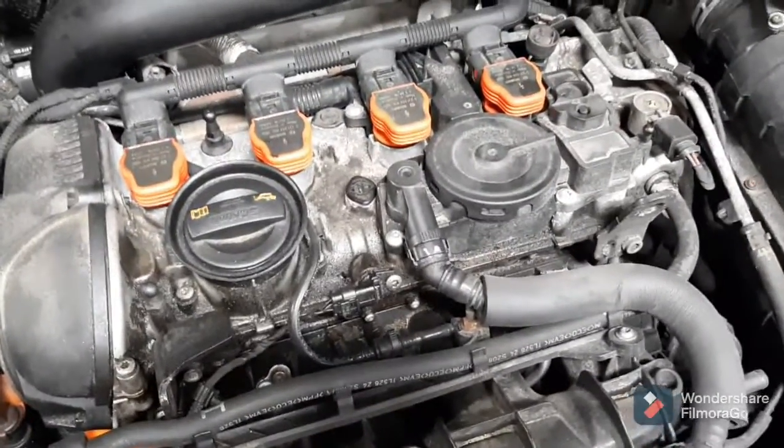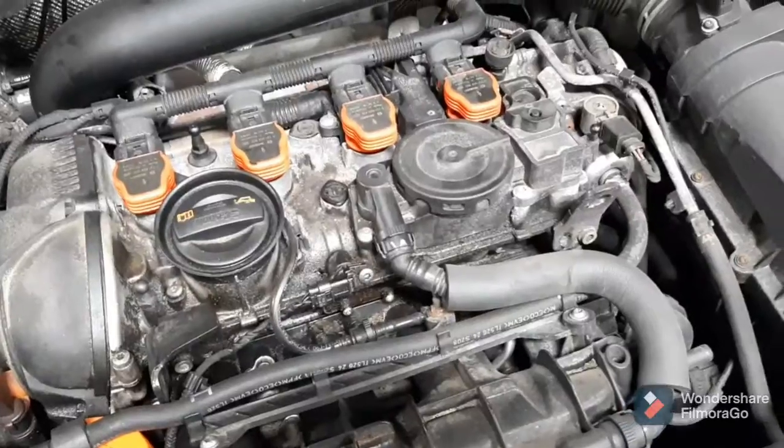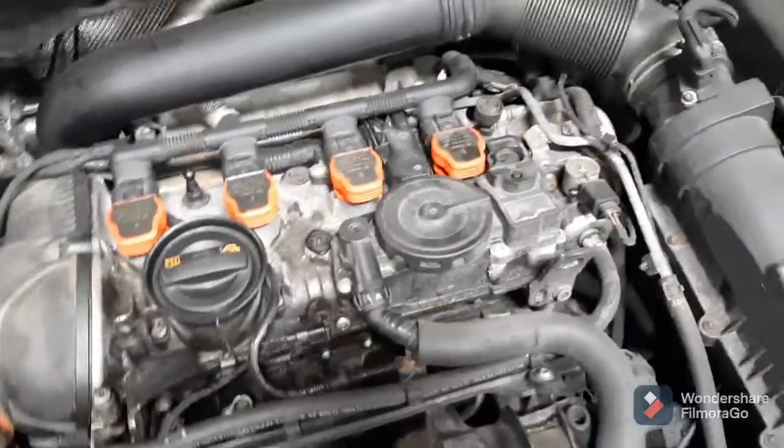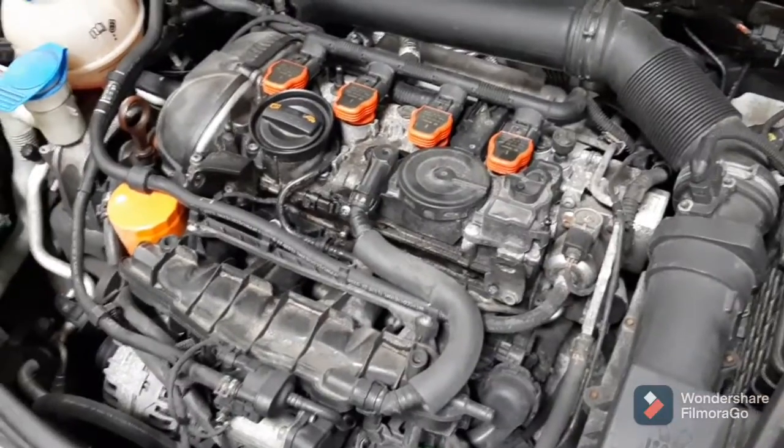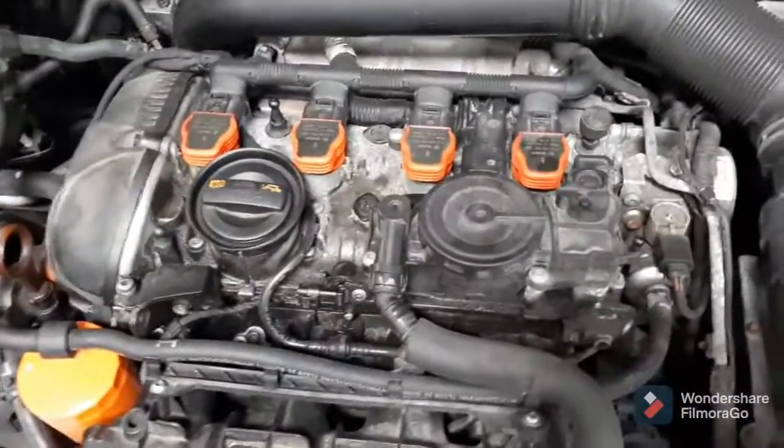Other than the whistling, this one's very apparent. Sometimes they won't really whistle, and you'll have mixture-related faults — it'll say air leak in intake system. That'll be another fault that'll be stored.